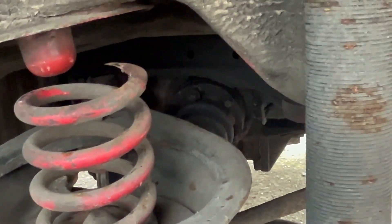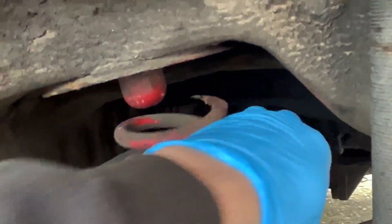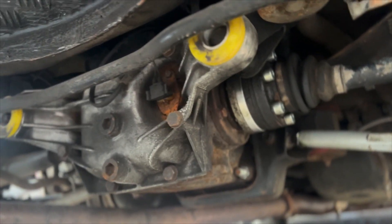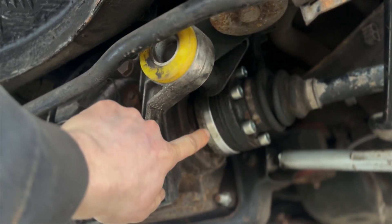There's a loose bolt right there, and by the looks of it there are a couple of loose ones in there. I think I'm going to re-tap the threads, clean it all out and hopefully they will stay in there better and not fall out, especially with those serrated washers. Let's have a look at the one I've already installed.